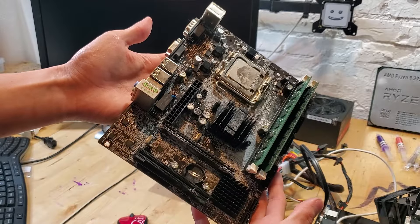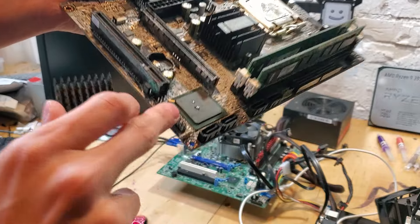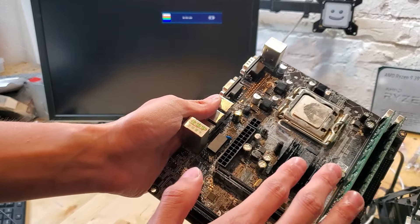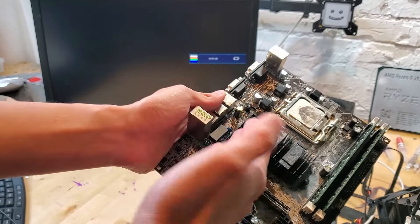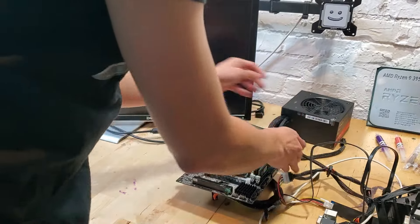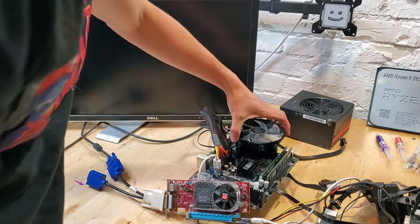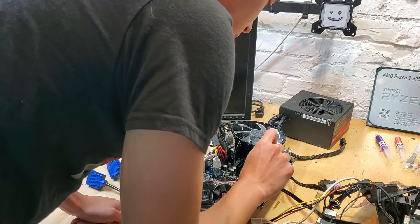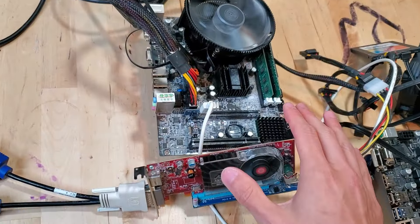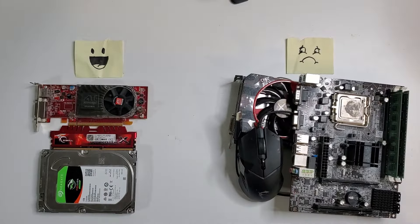Last but not least is the CPU, motherboard, and RAM combo. Right off the bat, this one has the most water damage by far — residue all over the board and one of the heat sinks fell off during extraction. This motherboard also has one of the worst layouts I've ever seen, with the power slots in the middle of the board. Since this system doesn't have integrated graphics, I'll grab the GPU we know works. As we short out the power pins, the fans do spin, but no matter how long we wait, there's never a signal on the monitor. The motherboard has breathed its last breath — perhaps residue shorted some circuits, or ice knocked some capacitors loose. It ends up in the not-working pile.